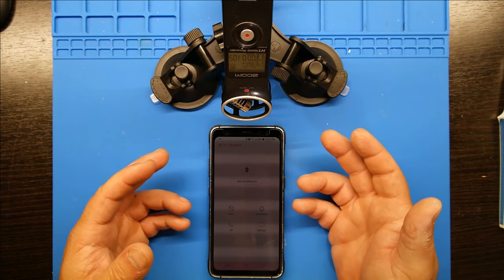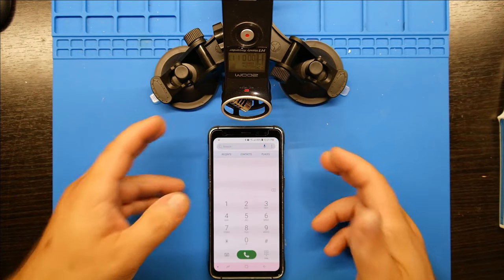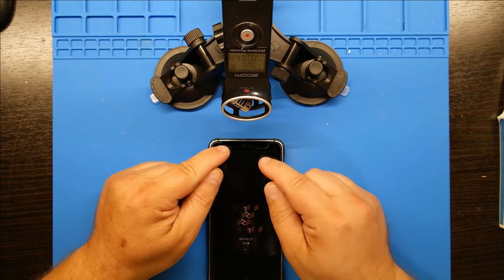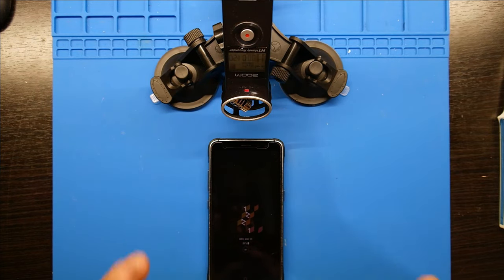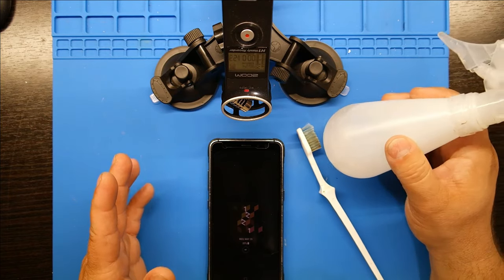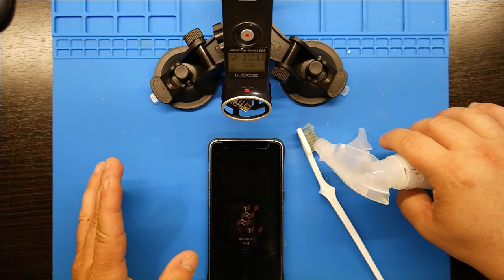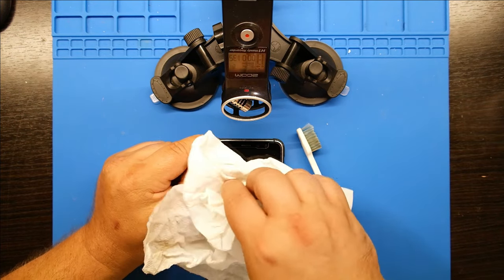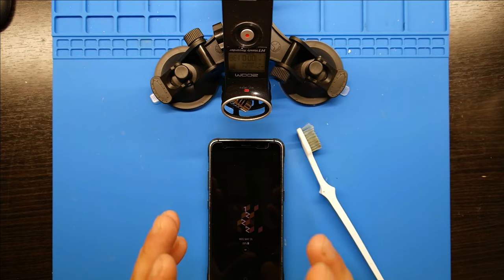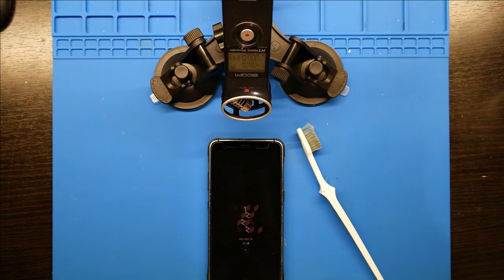So there you go — that was definitely a lot louder. If you have a problem with your cell phone call volume and you can't hear, check that first — it's probably all gunked up. Clean it with something sticky, blue tack, an old toothbrush, and some 91% rubbing alcohol. It works beautifully. I suggest spraying the alcohol onto the toothbrush and then rubbing it — it took me about four or five minutes of rubbing, wiping, and cleaning. It doesn't really soak through but it definitely got everything clear with no residue whatsoever.